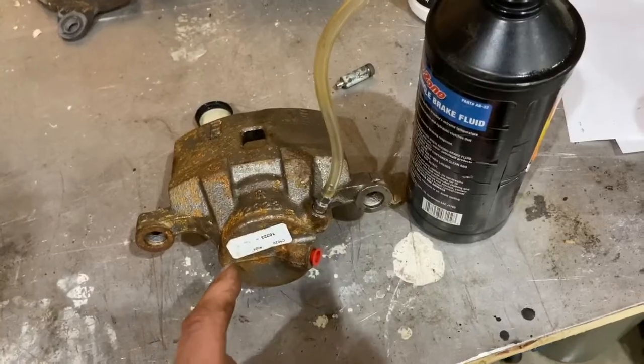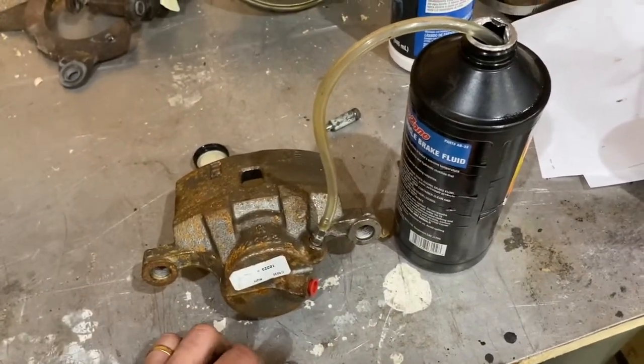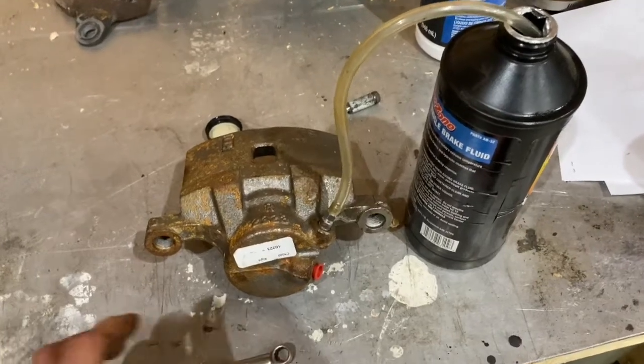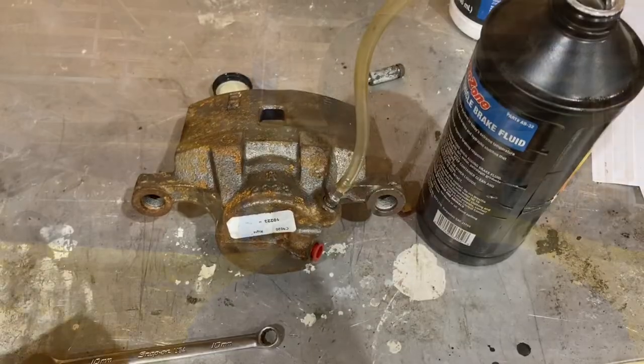The one thing you have to watch out for is that you don't run your master cylinder dry, because once you've done that, you get to bleed your master cylinder again, which is kind of a nightmare. Hopefully some of the tips in this video have helped you fix your brakes. If they have, or if you have any other questions or tips, leave them in the comments — I want to learn more and hear what you guys are working on. Thanks for watching and subscribing, and we'll see you next time.